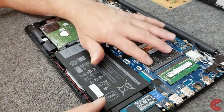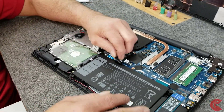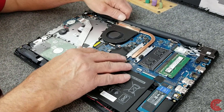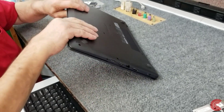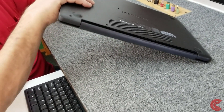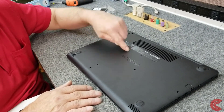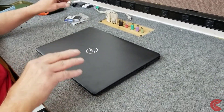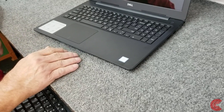So we had our extra 8GB of DDR4 — total of 16. Our NVMe 250GB and our new 1TB drive. Everything looks good, so we're going to reattach our battery — make sure it's in — and power back on. Just wanted to show you how on this particular model you can do quite a bit of work to do a nice little upgrade. Snap this all back on and of course put your screws back. Remember you've got three different length screws — one length here, one length in these three holes, and these other ones are another length. That's it. I appreciate you guys watching. I'm going to do a clean install and we should be good to go. Don't forget to subscribe, and have a great day.